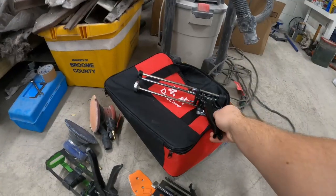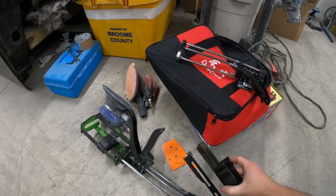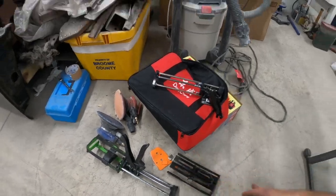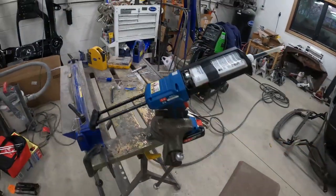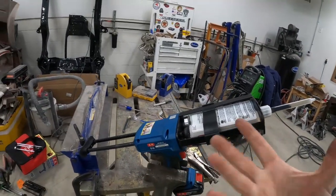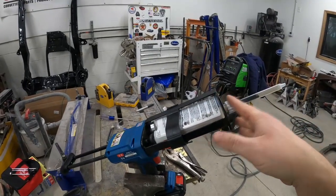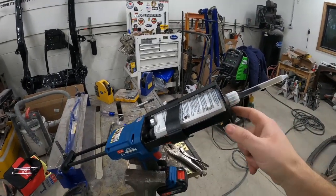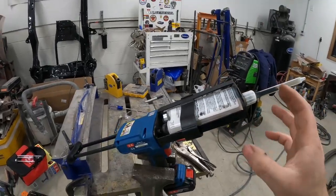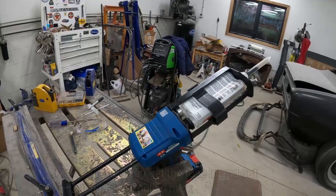So here's all the parts I didn't use. I didn't use the old mechanical mechanism, the flange that went with this, and the cage that went to the electric one. So what I did, which you probably saw in the video, is I took the flange from this one, the cage from the manual one. I had to cut about 1/10 of an inch out of it, so that this cage would grip the tube, and then I shortened it about 1 inch, so it's not excessively long.